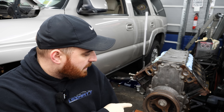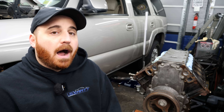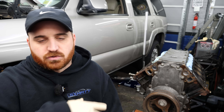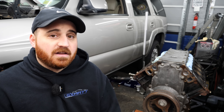We drilled and tapped a drain for the turbo, which this thing is eventually going to have, and that's all plugged up and ready to go. I'm still waiting on the heads to get back - they're currently over at Head Games Motor Works getting a full valve job, completely reworked, milled, whole nine yards. I'm supposed to have those back on Wednesday. As you guys are seeing this, it's Monday.